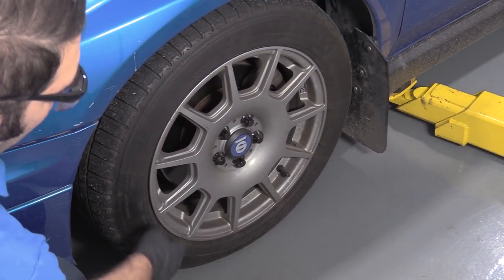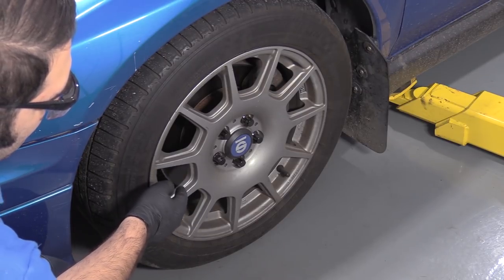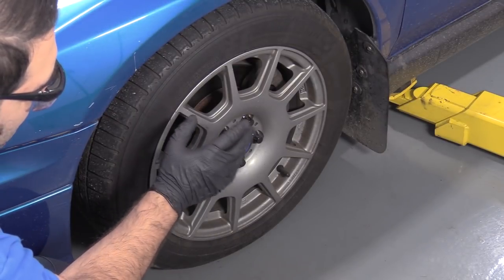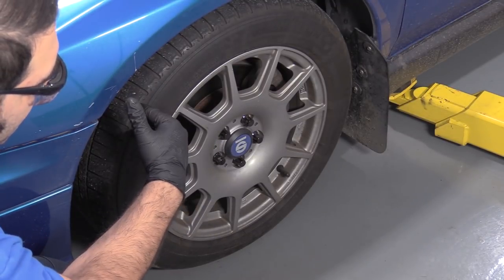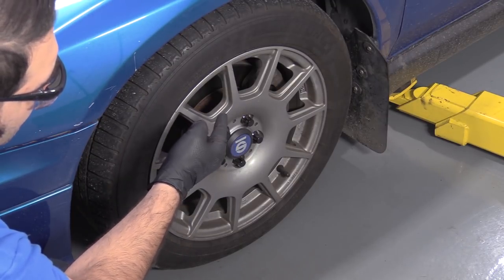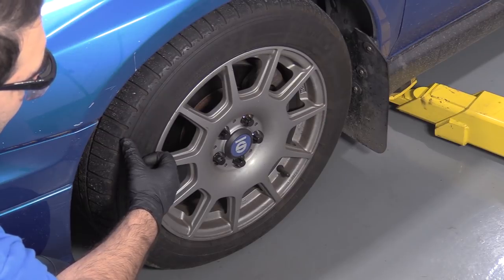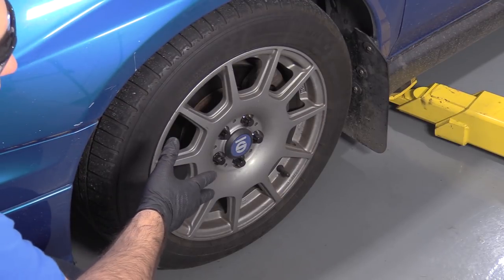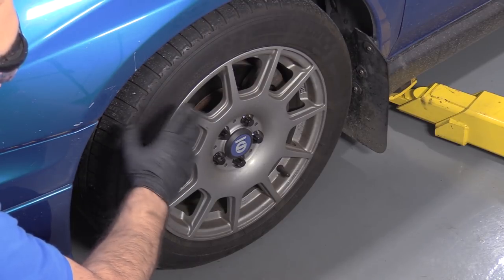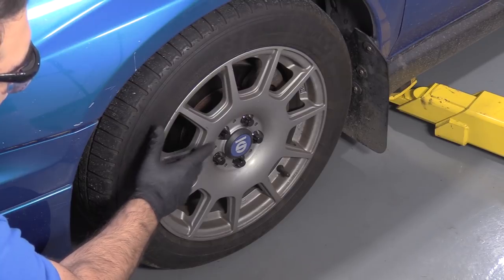Come over here to the driver's side. This wheel is again dirty with brake dust but it's not as dirty as the other side. I'm curious now and I think that this caliper — you can also look through the wheel here — it looks kind of rusty, maybe older than the other caliper. Maybe the other caliper was replaced at a different time and this is original. So I believe that caliper is seized up. I'm going to lift the vehicle in the air, take the wheels off, check it out some more, and show you how to replace these calipers. You should do them in pairs — it's best practice — that way you know both are up to snuff and performing properly. You can buy those pairs of calipers from 1aauto.com.